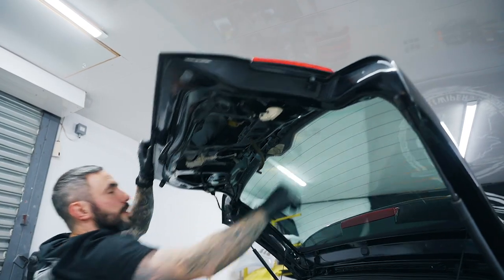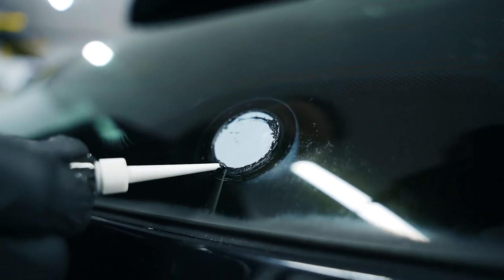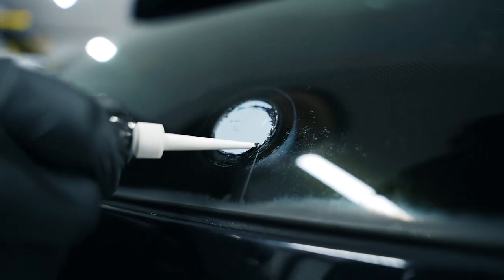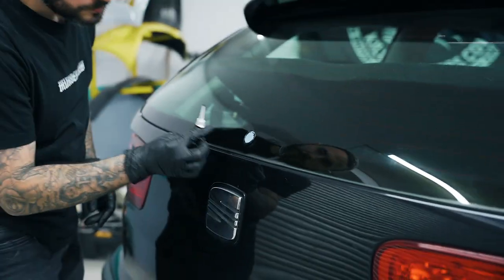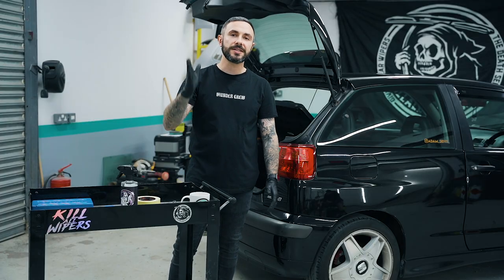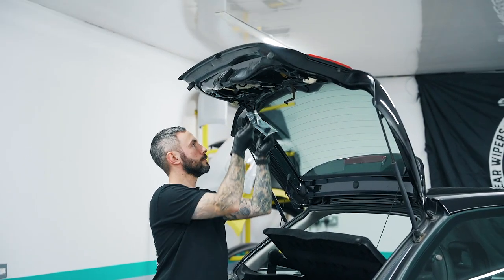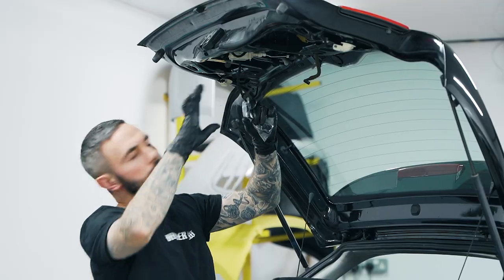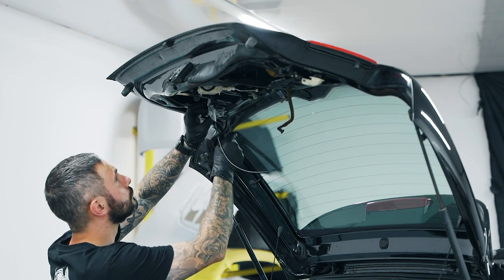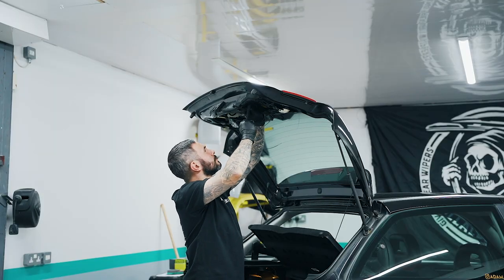You might notice that some of the sealant has come onto the outside of the glass — just wipe this down. If you wipe too much away, use the needle to apply some sealant around the edge and give it a quick clean. Make sure no sealant sets on the glass. Whilst the kit is setting, use the bag it came in to cover the electrical plug, cable tie it, and also cable tie your washer jet pipe out of the way — we don't want those rattling around in the boot.